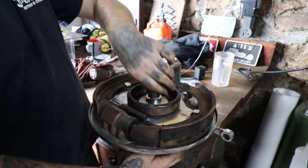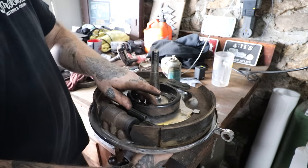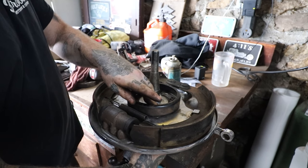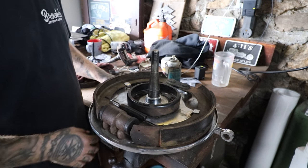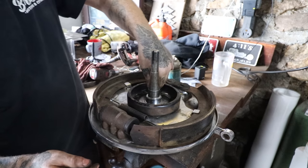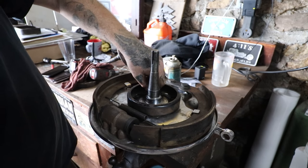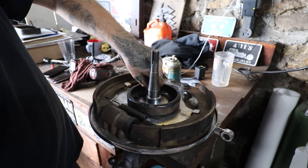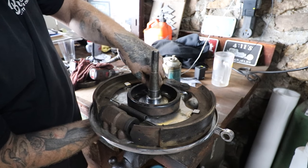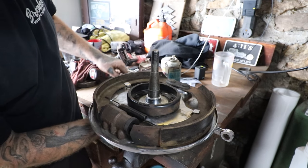But I also had to grab out of my stash, which probably took longer than all of this, some of these grease shields for a Model A. Again, they have the smaller bolt pattern, and you need to use those as well, because the later ones won't work, because obviously the bolt pattern's incorrect, and we don't want to drill out those grease shields. So I just grabbed some bolts, finally found two decent grease shields from a Model A, and I should be on my way here. So I'm just putting these bolts in. You want them to be a nice snug fit like this.